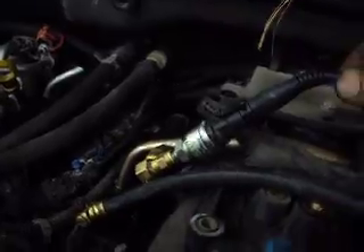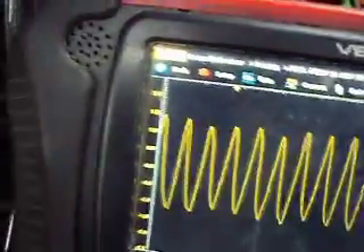I also got hooked up over here — I got the pressure transducer on the fuel line, and I got that set up to channel 2. We'll disconnect this for a minute. Our pressure will bleed down. I found out when I was doing this that we actually have a bit of a problem here — you can probably hear all that fuel running through the fuel pressure regulator. So we'll go back to setup.